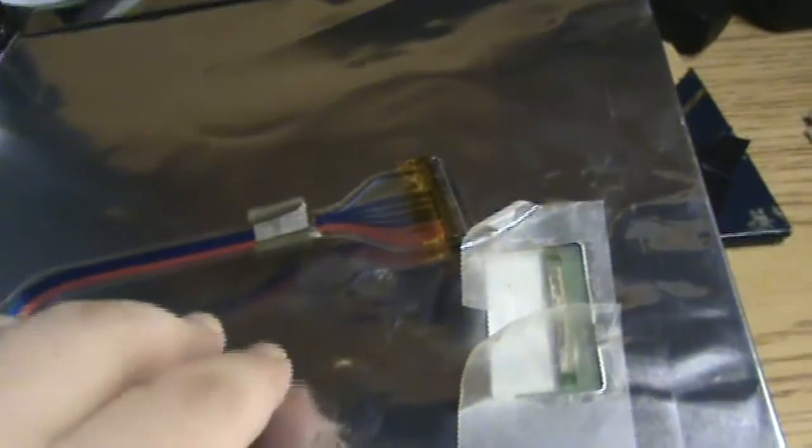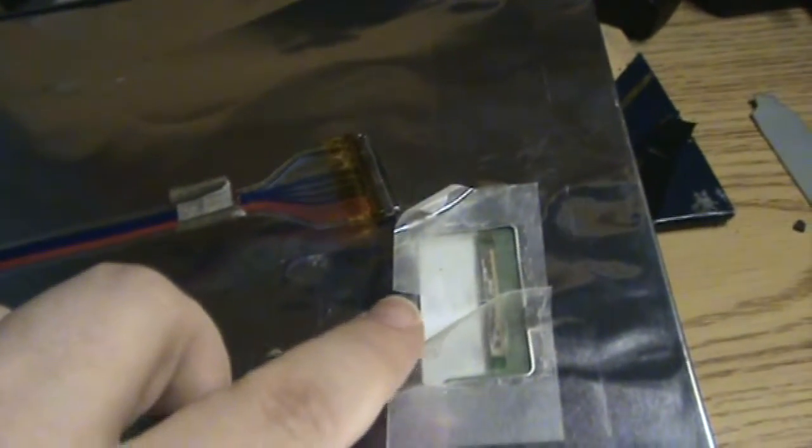Here's the video cable which I've removed, keeping in mind the connection area I have to be careful around. I'll lift this up, take out the side screws through the internal frame, and take out the LCD screen. On some laptops at this stage it's optional to keep the metal framework attached and simply unscrew the hinges below and swap out the whole metal frame. However, on the NC6400 — and the NC6120 is very similar but there are differences — there were more screws on the LCD bezel case than on the other one.